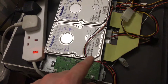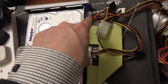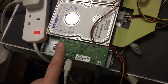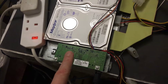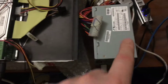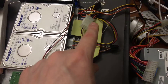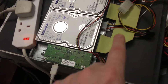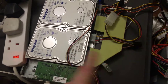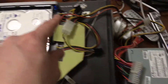Obviously this would no longer power up properly, so I took the case off and noticed it used two molex connectors to power the drives, which were connected to the controller board. The power supply wasn't supplying enough power to run both drives, so I grabbed a PC power supply — which has molex connectors — unplugged the two drive power connectors from the controller board completely, and plugged two molexes from the PC power supply directly into the two drives.